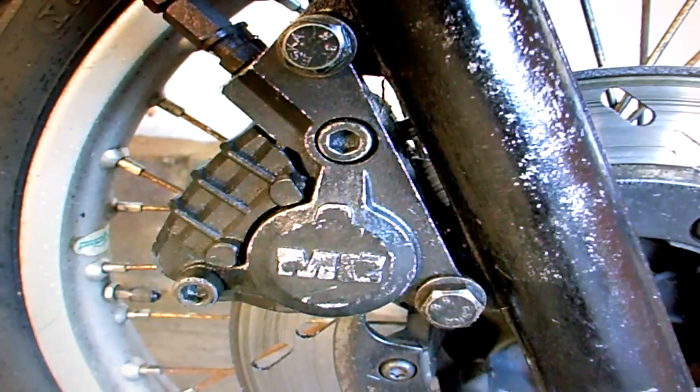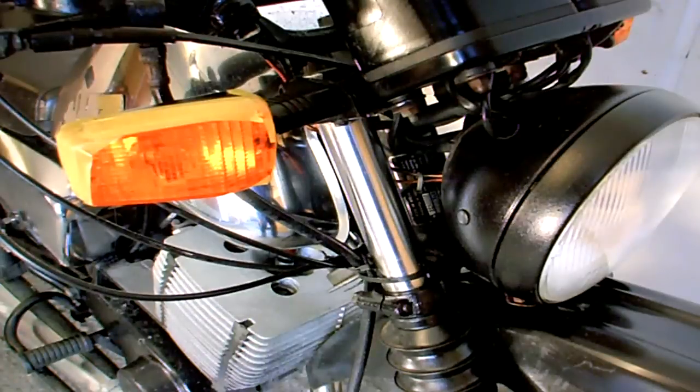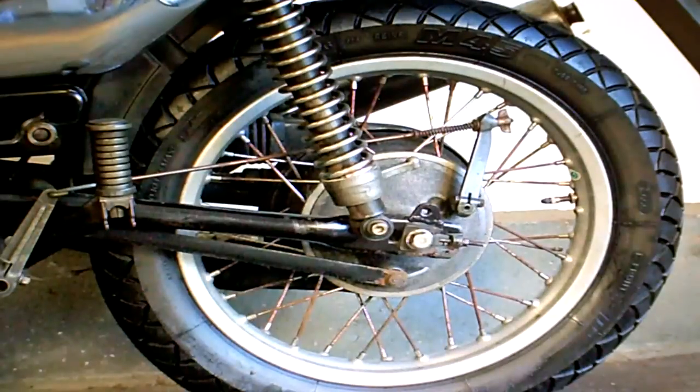The front brake seems to be binding a little bit. Once you look around the bike you might find other things I haven't spotted — maybe things like forks that might have gone a bit hard and want a bit of using, that sort of thing. It's not binding badly, but it's enough to make me think you might have to do something with it. Somebody has also taped on an indicator lens with some yellow tape — they could have used black tape or even changed the indicator lens.